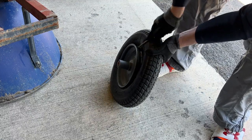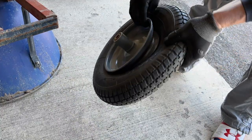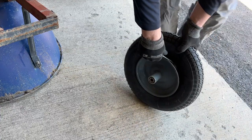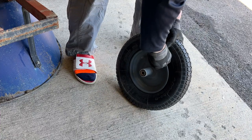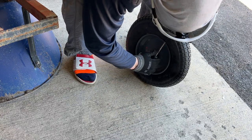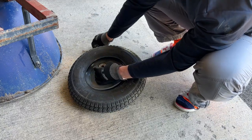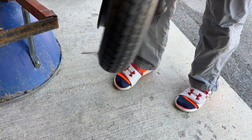See that - one motion. Worked our way around the tire and towards the end it just broke free. In the same motion with the screwdriver, we can get under and over, run the screwdriver around, and pop the tire off the rim.